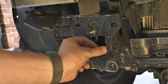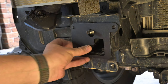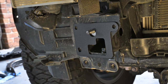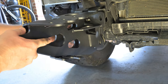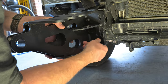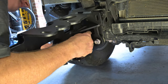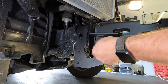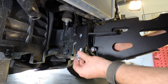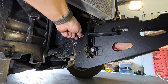Now move back to the front of the vehicle and get the mounting kit for the bar. First place one of the teardrop nuts into each chassis rail as shown. Then place one of the chassis mount spacers onto the front of each chassis rail, orientated as shown. Next place each of the bar chassis mounts onto the chassis rails. Loosely install one of the original Toyota bolts onto the inside of each bracket, then insert the supplied rat tail nut into each chassis rail. Move to the outside of the rail and install another Toyota bolt, then loosely install the supplied 16mm bolt into the outside of the rail and screw it through into the rat tail nut that's inside the chassis rail.